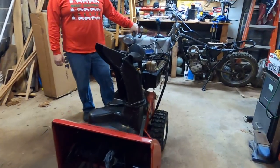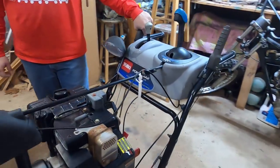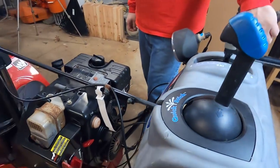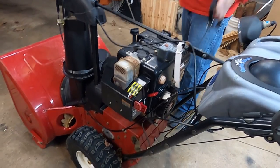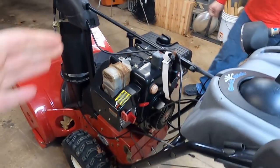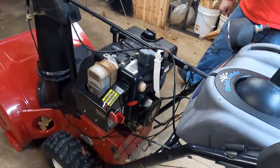All right, now the first thing you're going to want to do when you pull up on one of these fancy pants machines that allegedly does or does not run is make sure she's not seized up. You remember that lawnmower we brought home was seized. Give the old pull start a tug. You want to make sure it's got compression. Hear a couple burps. Make sure it doesn't sound like there's marbles in there.